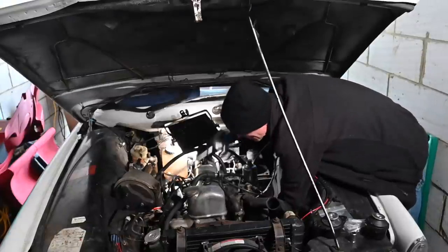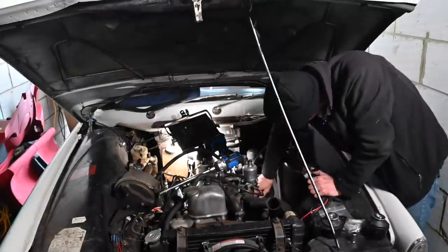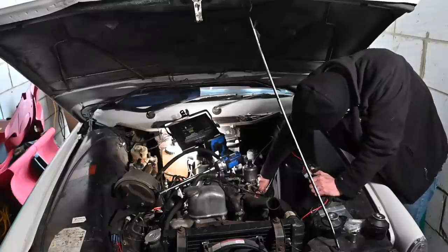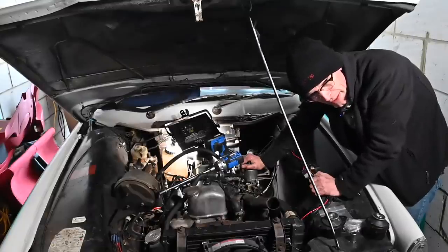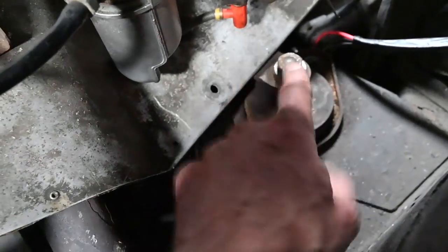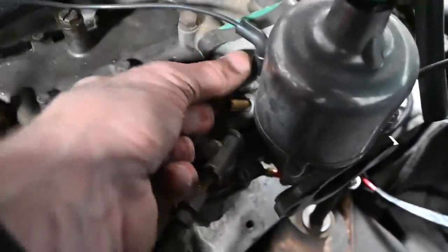It's out — I love this tool so much. Now one little issue I hadn't previously been aware of: this bolt is slightly longer than the access to remove it. So that's going to remain static once I've lifted the engine up. I can either take the carburettor off or go and get an angle grinder, but there's no power out here so I can't run an angle grinder. So I've got to take the carburettor off. You can see the engine mount which comes off the side of the block — when I lift the engine up, it won't come past the bottom of the carburettor.